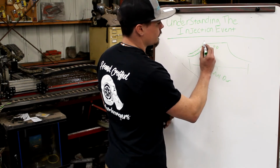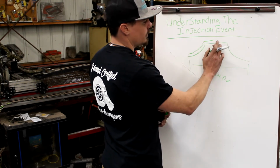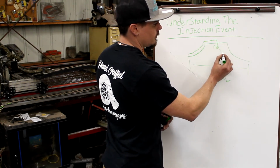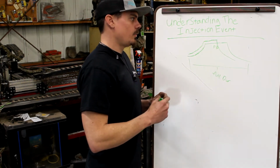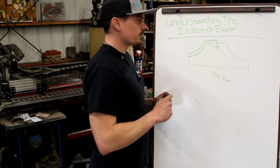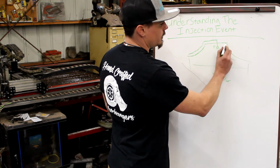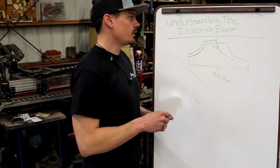at lower RPMs. As long as there's enough turbocharger and the turbo's aligned, power goes up. So the fuel quantity's gone up, but peak will go down. All of a sudden, the injector closes early. And it looks just like that. It looks kind of like that, but more abrupt, because as the engine RPM goes up, the pump's trying to move more and more cc's through that injector in a shorter amount of time. So the refill rate, or the ability for the system to refill, becomes inadequate, and it can't maintain pressure in the line for the full duration of the event because there was not enough time to refill its spill port or its fuel galley inside the injection pump.